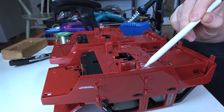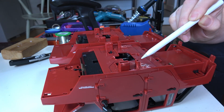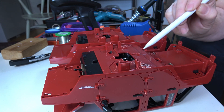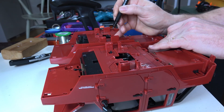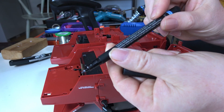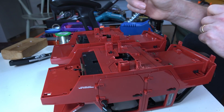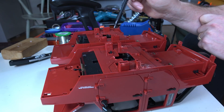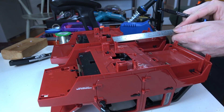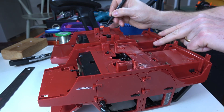The first thing I'm going to do is trim out the back half of these tabs here. The reason I only trim out half is because this is part of what holds the inside of the car together and it's only necessary to remove just over half of it. To make it easy to see where I'm going to be cutting I'm just going to mark it with this pen — a laundry marker pen from Staples, really handy for this sort of thing. It doesn't rub off with your finger once dried, however it will come off with alcohol. I'll mark where it's going to be trimmed using the ruler — somewhere around five millimeters from the front — and I'll do that on both sides.